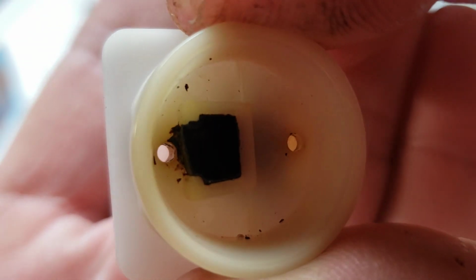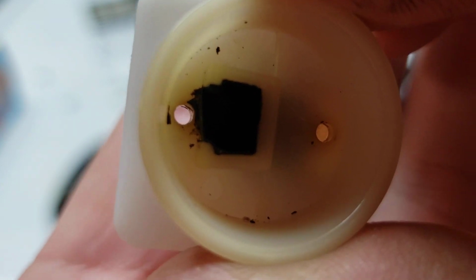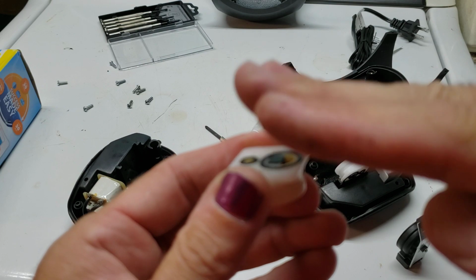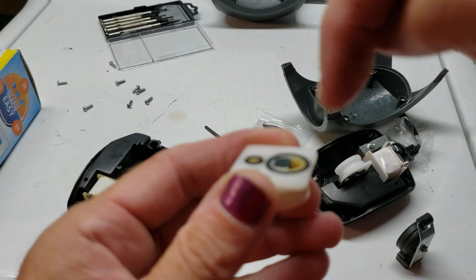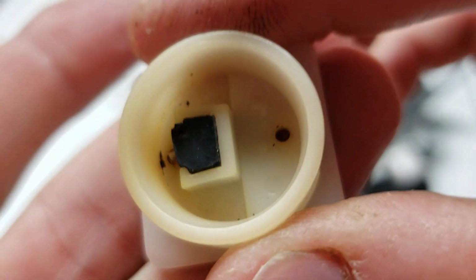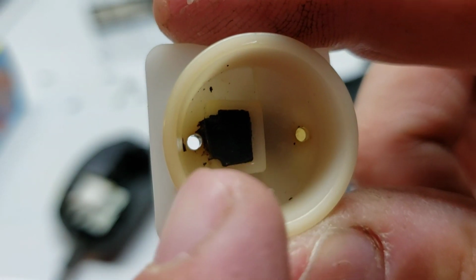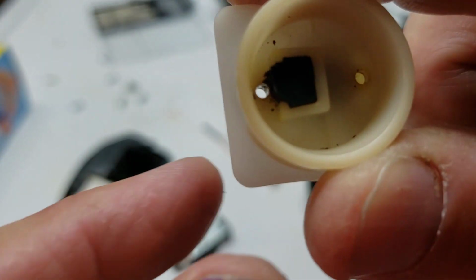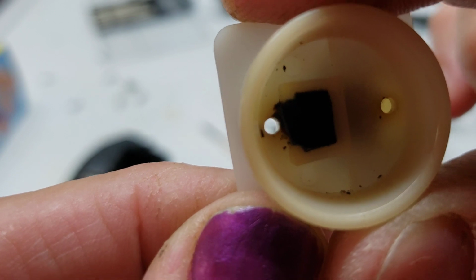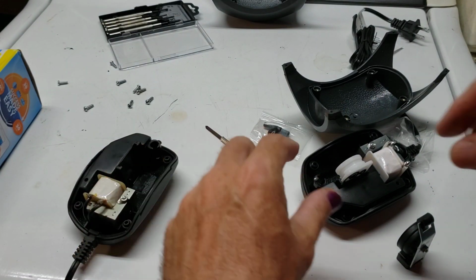And what I did was cleaned it all out, and then I wound up being left over with this open hole that goes straight through. You'll notice you can't see straight through this hole, and that is because it has a way for the air to move through this piece of black plastic, and then that black plastic is a little valve. It flaps open this way that lets the air escape, but then the air can't go back down through that valve. And this is supposed to be one of those valves, but the part of it that goes from the opening to the valve was sort of deteriorated and rotted away, and when I cleaned it out, I actually removed all of that stuff, and it now does indeed allow the air to simply flow back and forth through the whole thing.